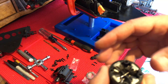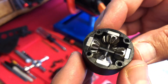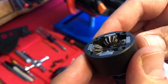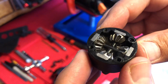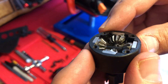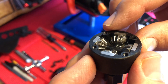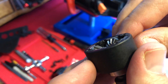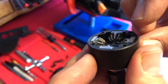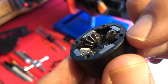I wanted to stress the importance of getting a close look after you get these diffs back together — make sure you've got enough oil. I noticed this one was leaking so as you can see it's low and I'm going to put a little bit more oil in it. I also noticed that at each of the points where the screws go in you can see a slight burr here — you can see it kind of raised here.